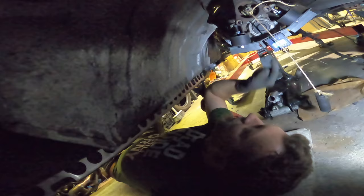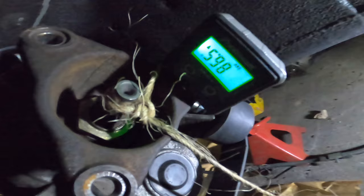Let's check it out. So I'm using this advanced technology called a rope to center line the drive shaft, so it's in the middle. I got also this magnetic thing, so yeah, we're all leveled. This number shows the same number as on top of the engine, so the gearbox is straight. I can check out the angle of the engine here. I cannot read it, you can read it. Which is 4.5 degrees. That should be within acceptable range.